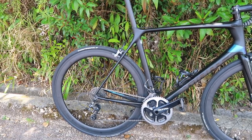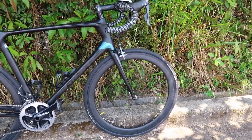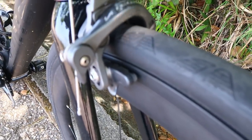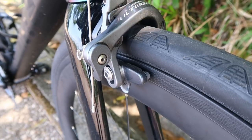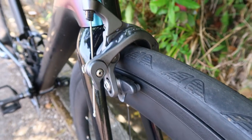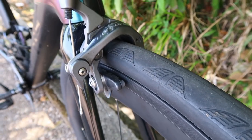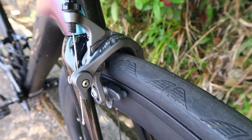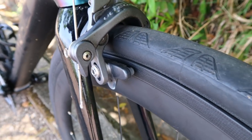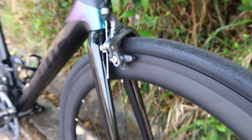One thing to know about the brake pads is that they wear down really fast, but I prefer the soft compound brake pads to wear fast rather than the brake track on the rim. I'm going to put my neck on the line and say these brake better with these pads than my aluminium wheels. It's basically the pad compound - it's so soft it offers really good modulation. The harder compound Shimano pads that come standard with Ultegra brakes on aluminium wheels feel a bit on-and-off, whereas these give real modulation with the lever - not disc-level modulation, but they work really well, though they wear out fast.